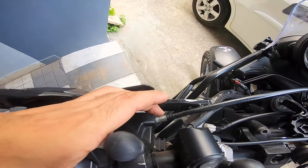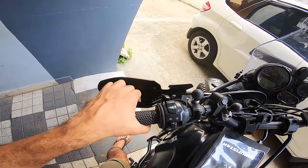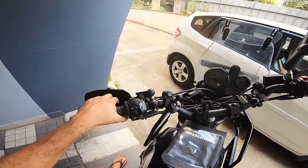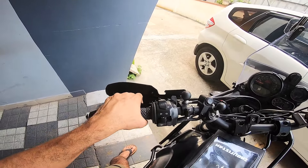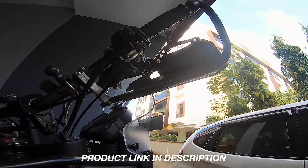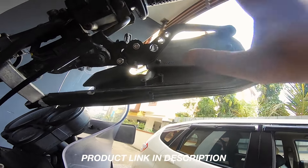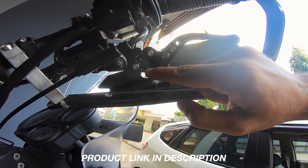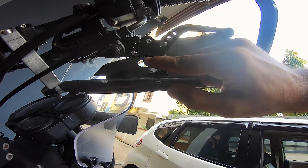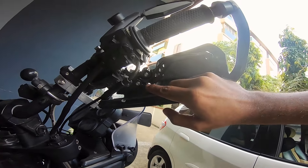Now coming to the clutch lever. The advantages of an adjustable clutch lever is, again, reach — especially when you do a lot of off-road terrain. You don't want to stretch your fingers and grab the lever and manipulate it. For you to keep playing with the clutch and feel comfortable about it without developing arm pump, it's always good if the clutch lever is closer to the grip. Always good to have two to three millimeters of free play right at the perch, and then if this allows you adjustment and you can get your lever closer to the grip — nothing like it. Your arm pump will just cease to exist if you have a quick reach to the clutch lever.